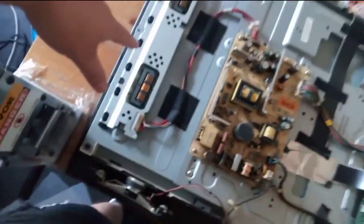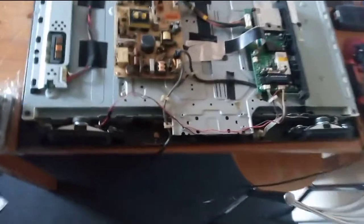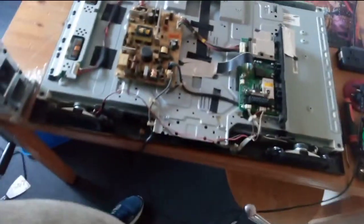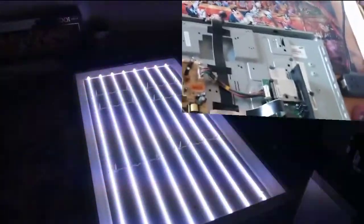Here's the next one — a Toshiba. As you can see, there's a blatant smash in the screen in this corner. However, the rest looks like a T-con problem, so I won't list the T-con. The main board should be okay, and obviously the LEDs or LCDs will be okay too. Let's rip it apart. That's the back off — we've got our inverter, power board, and main board. I actually can't see a T-con board. We'll try and get the screen off and get those LEDs lit up for a photo.